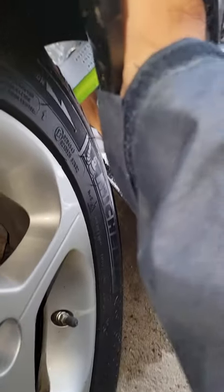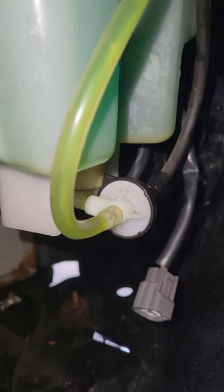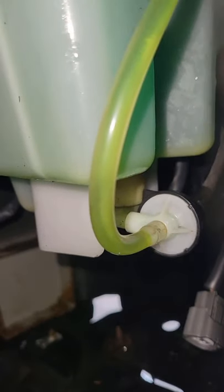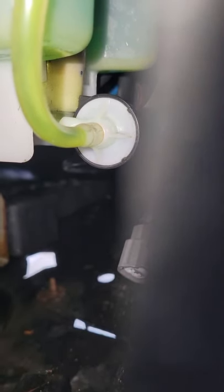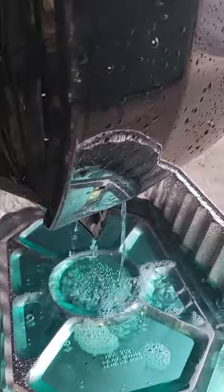So I'll reach in here and unplug it. With the power disconnected again, I'm going to pull that pump right off of the reservoir — that's why I've got this pan underneath. The pan is going to catch all the liquids. I'm going to pull the pump off the reservoir, which is full of liquid, and it's going to drain down into the pan. Then I disconnect the pump from the two hoses. You can see the one that looks yellow going into the white nozzle, and there's a black nozzle on the other side that goes into a black hose — one goes to the front, one goes to the back. You can see the windshield washer fluid draining because the pump isn't there to hold it all in.